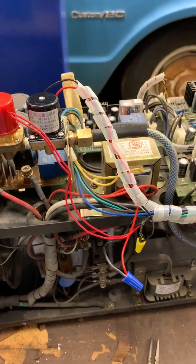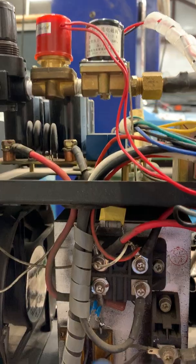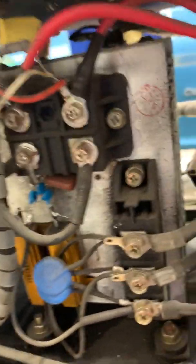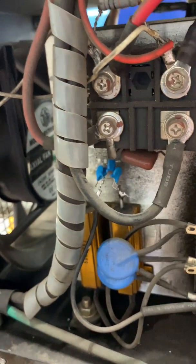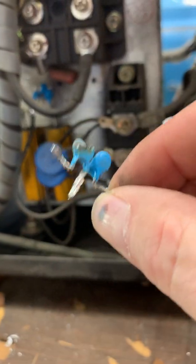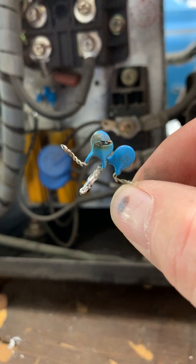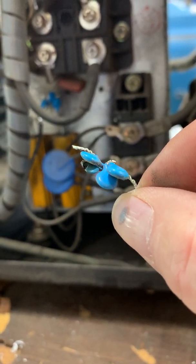After a little visual inspection of the machine, I also found just below where the solenoid is, there were these little capacitors down here right in here. The old ones had blown. You can buy these online for less than four dollars for a pack of five.